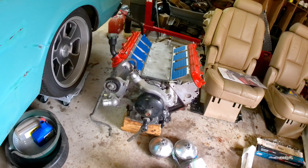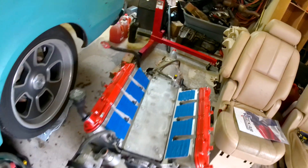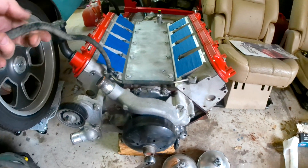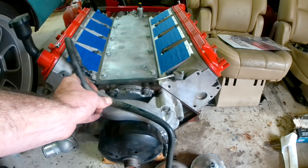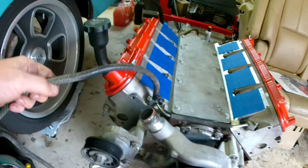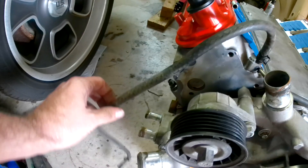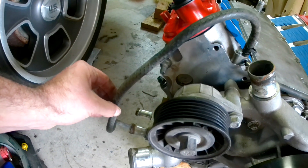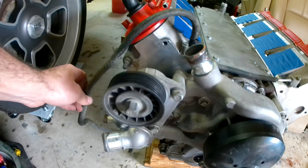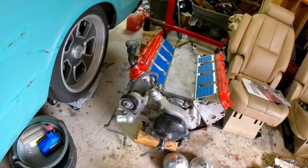As you can see here, I've already put the water pump on — I forgot to start filming so I didn't show you guys that. I put the vent tubes on and the block-offs for the back with new O-rings. The thing I'm trying to plan for right now is what to do with the steam line. I've heard a lot of people tap it right into the top of the water pump, which seems to work good, but I don't think I'm going to go that route. I think I'm going to go the simple, non-drilling, non-tapping route — put a loop on the actual water pump and then put a quarter-inch fitting that goes into that loop and just have the steam port run into there. It seems to be the simplest plug-and-play option I can come up with, but it might look messy.